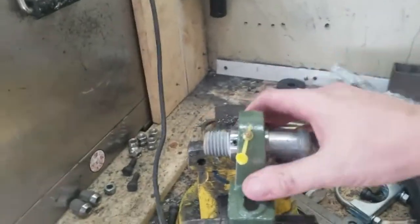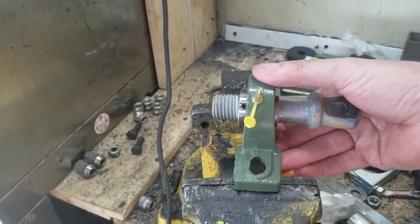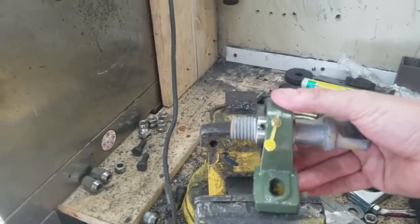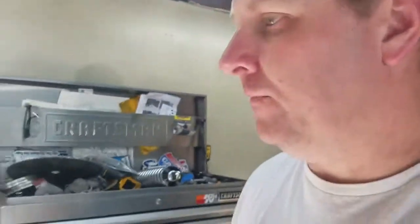So if I want to change my pinion angle where this flat plate will be, I can just add a plate under it, or put a nut or something under it on the mounting bolts and move it left or right a little bit, but mainly I can adjust it up and down off of the mounting plate so that I can change pinion angle if I need to. So theory looks great. We'll see how that works in application.